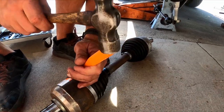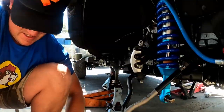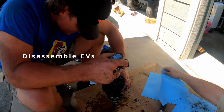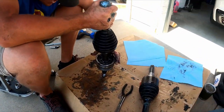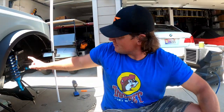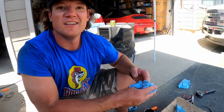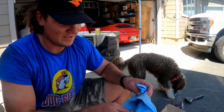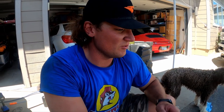I have to take this whole thing apart and replace the center section with a longer one, but they don't have the right tool to pull these apart. We're replacing the axle shaft with that longer piece. The new one is a little longer than the old one. We took off the upper control arm, the lower control arm, the sway bars. That's the old axle shaft and this is the new one — it's wider, because the whole setup is going to be three inches wider than stock. I'm re-greasing these and sealing them up. Austin has got the new control arms on and we just have a couple more things to do before we put it back together.